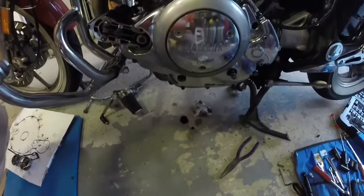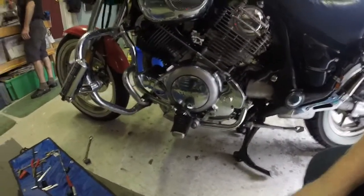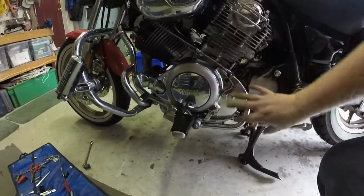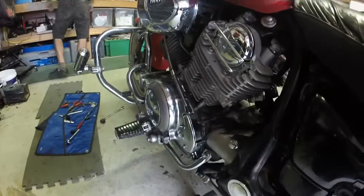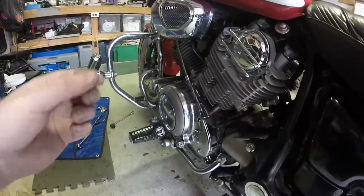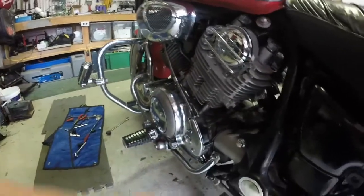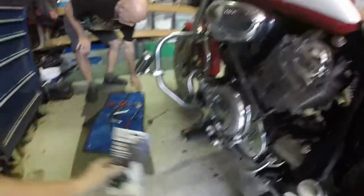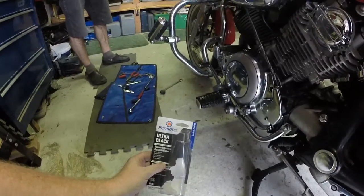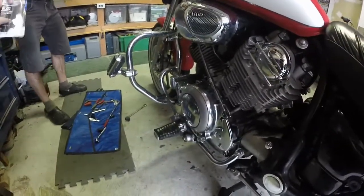I am dripping oil again. We are on day six of my four, maybe five hour project. The problem with the gasket wasn't necessarily just the gasket. The gasket was probably seated correctly even though it was leaking. It was leaking out from back here - where the wiring grommet interface is - and it wasn't being pressed down. The cheap eBay replacement is just a little bit loose, and when running under pressure it was forcing whatever oil was splashing up out and dripping down. Advice: Permatex - just saturate your gasket with it, then place it nicely on the outer case and it holds it in place while you put it in.